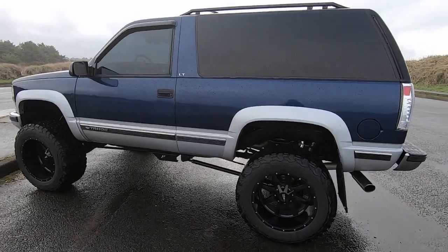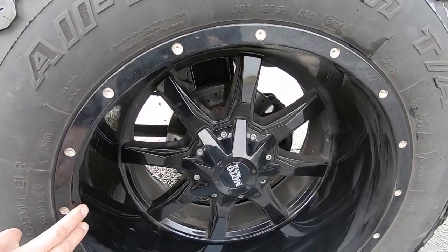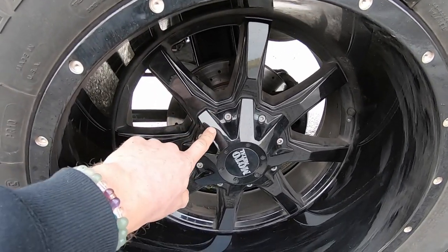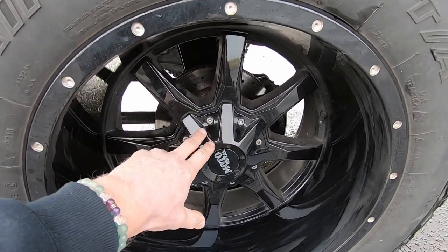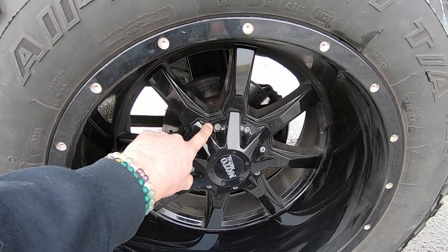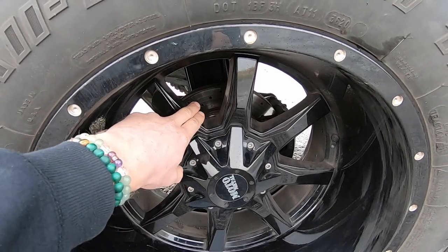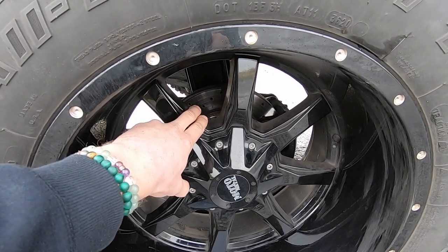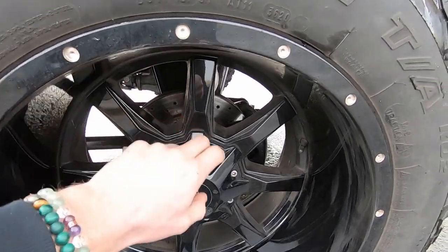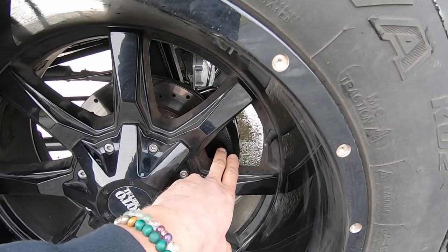When I was digging into this, I was having braking issues because this was sitting for so long, and I realized that my back wheel seals, the wheel bearing seals, because we rebuilt the whole rear axle, were leaking, and so the brakes were getting differential fluid all over them, and so they really weren't working. Also, the back calipers were both basically kind of frozen up.